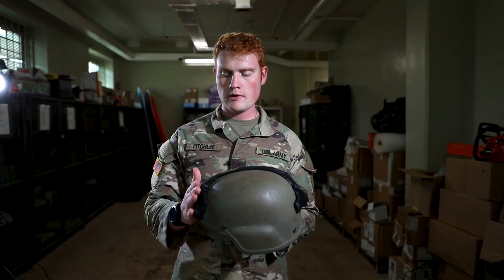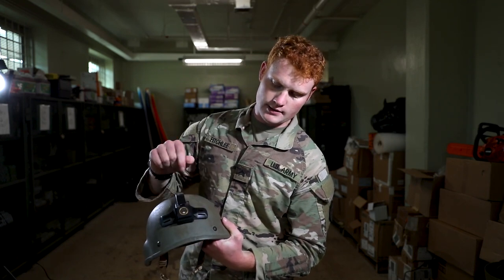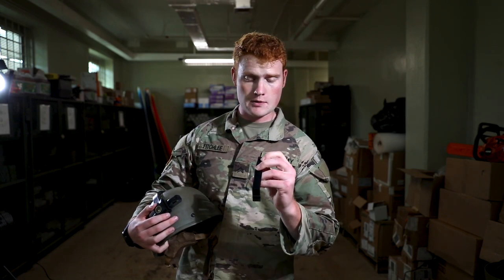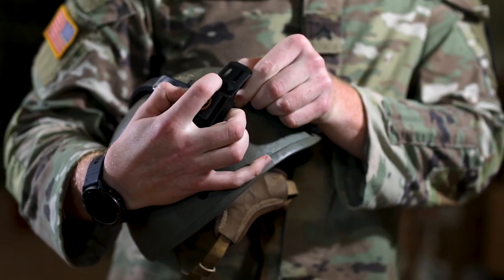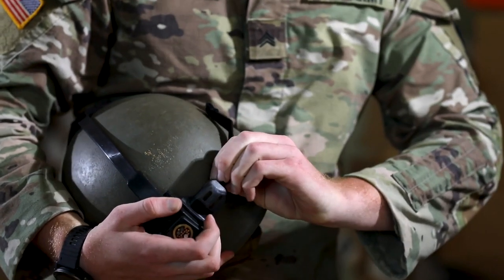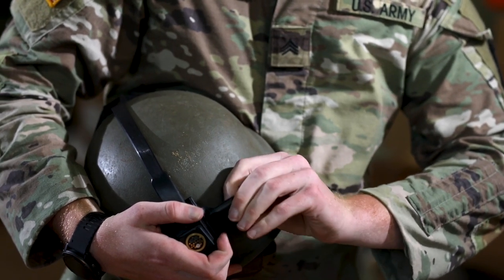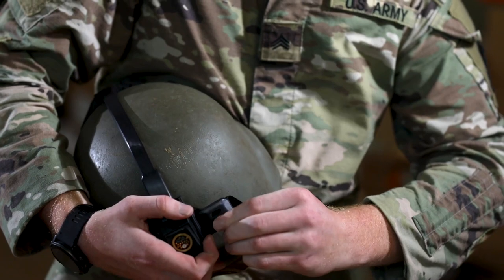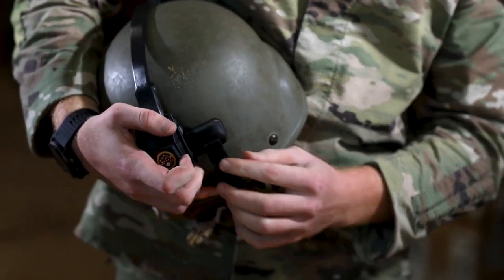Make sure to keep all these wires right up inside the mount — you don't want those getting exposed or getting pinched between the helmet and the UHMA itself. Take the standard screw through the front, take this piece, and it goes in. Now that we have the front part mounted, take the back part — there are two small slits. Take your small Velcro strap, getting the fuzzy side inside, and take it through the back, feeding out. That small piece will sit up inside of it. Do the same thing to the other side.